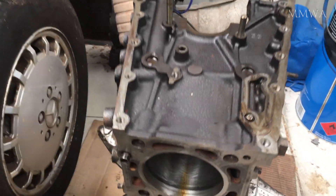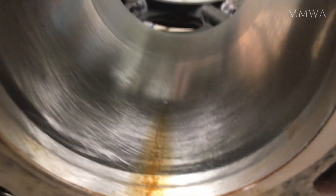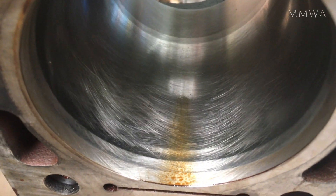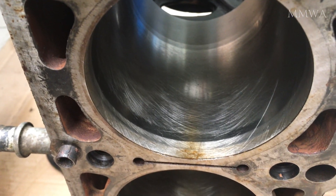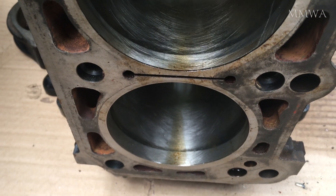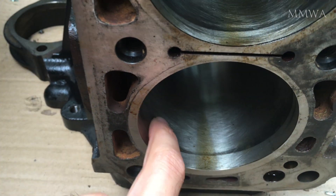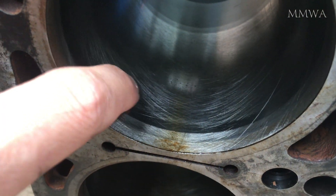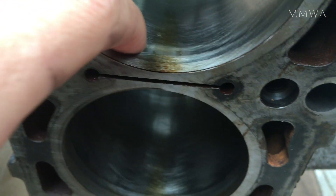Here is the Red Project's M104 block. Don't pay much attention to the cross-hatching patterns — that was just me screwing around with a honing tool, as I knew the engine was being rebuilt anyway. There were still some honing marks left, which is remarkable for an engine with 307,000 kilometres. What's not so remarkable is the wear in the piston reversal areas — not so much at the bottom, but at the top. The bores do measure to specification in the middle, but that's only one-third of the story. The upper and lower reversal areas also need to be measured, and while I could not measure a difference with the measuring instruments I own, I can actually feel it.